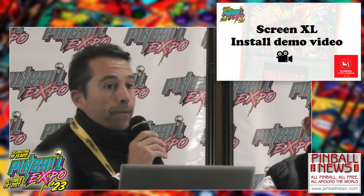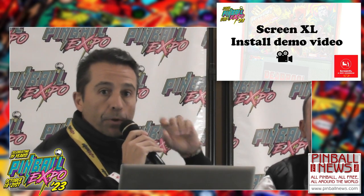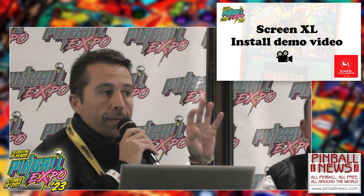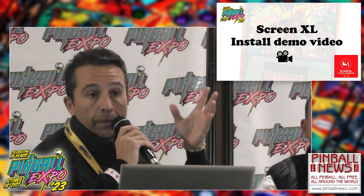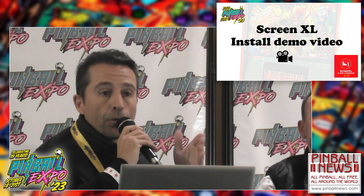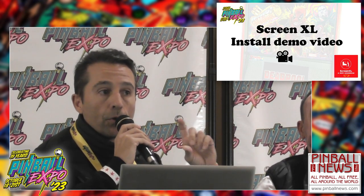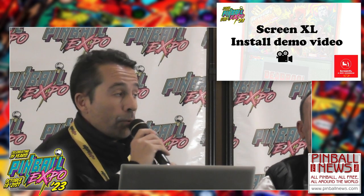Okay, one comment on the video, hope you liked it, is that we just realized that Stern machines with the original code, the code that comes out of the factory, don't have a brightness setting. So you need to update it to, I don't know if the latest, but one of the next codes in order to make the settings menu extend to number 90-something, because 94 is the setting where you can change the brightness of the screen. If you're on original code, you will not have this option, and therefore it will work, but it will be on the lowest brightness. It's an important point.